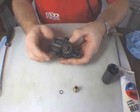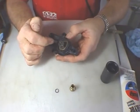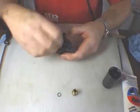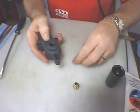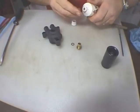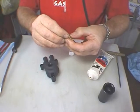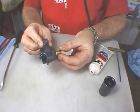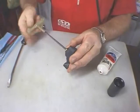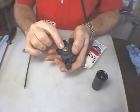I have the snap ring reinstalled. If you want to test-rotate this assembly, remember always counter-clockwise. If you were to rotate this clockwise it's possible that you would loosen the impeller, so always test it counter-clockwise. We have a smooth movement. Then we have this small washer that is going to sit on the shaft first before this bushing. I'm going to take a small amount of silicone grease, lubricate this area, put the washer there and put it back together. We want to tighten this just snugly because we don't want to squish that nylon seal and damage it.